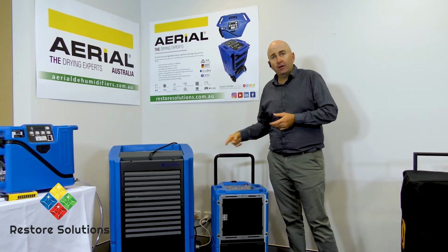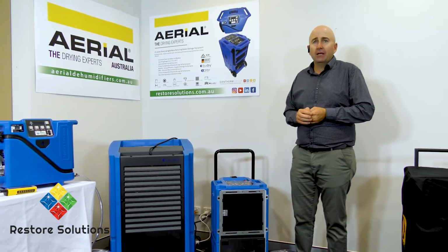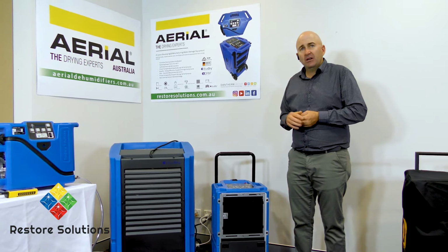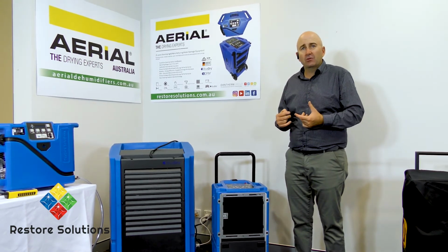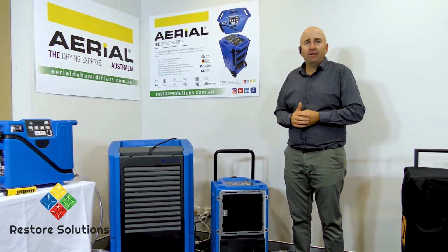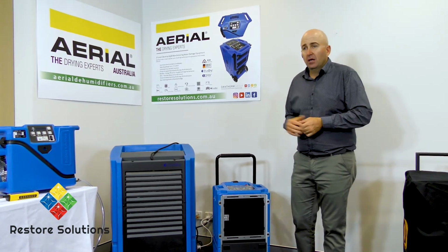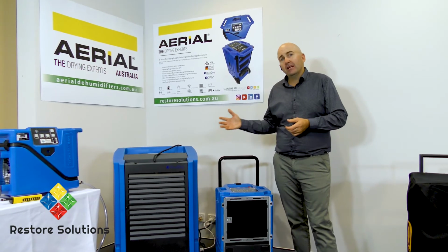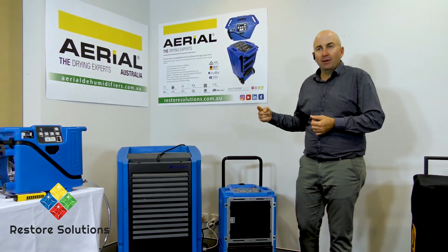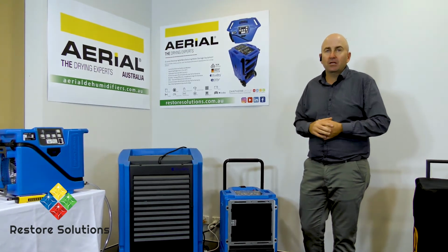And then you've got to look at airflow or air exchange. A lot of the times people say, well, how much does it pull at AHAM? That's how we'll work out our formula. But then you go, well, hang on, what about the air exchange? That formula doesn't always make sense. Because if I've got a unit that pulls 55 litres at AHAM, and a unit that pulls 35 litres at AHAM but has double the airflow capacity, over 24 hours I'm doing twice as much air exchange. It's completely different to your drying job.